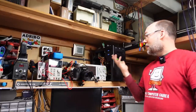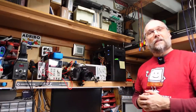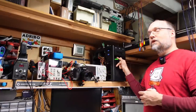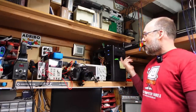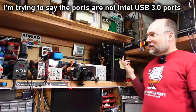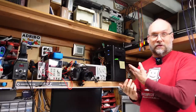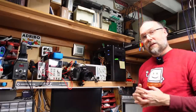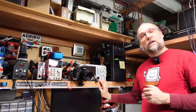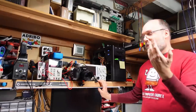For a long time this all worked fine, but then this just started happening all of a sudden and I can't figure out what's wrong. I've deleted the USB 3.0 ports from Device Manager and let them reinstall — no fix. It's not native to the chipset on this board; it's a really old motherboard even though it supports this third-gen chip. The USB ports are third-party ones, still using Microsoft's built-in drivers. There are only two USB 3.0 ports on the back and I've tried both — same problem. I've gone through the BIOS settings and there's nothing you can do there, just enable or disable.